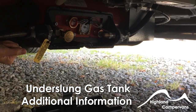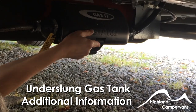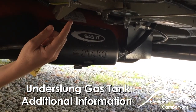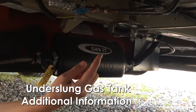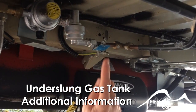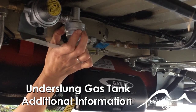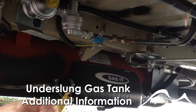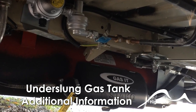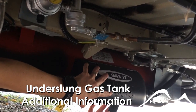Turn the brass ring all the way until it comes to its end stop, then turn it back a fraction, and return the cover. You'll only need to close it off if you're shutting the vehicle down for winter months or if a ferry operator wants you to disconnect the gas at source. The regulator — a Drive Safe regulator — has a reset button on the other side of the vehicle. Press it in for a count of three then release. That regulator only needs resetting if you switch the gas off completely or if the vehicle has been in a collision, as it's a safety cutout valve that senses vibration from an impact.